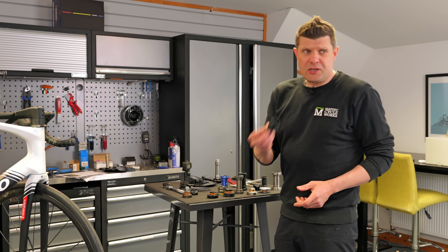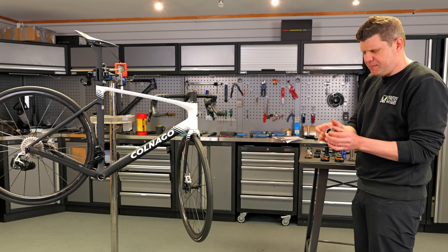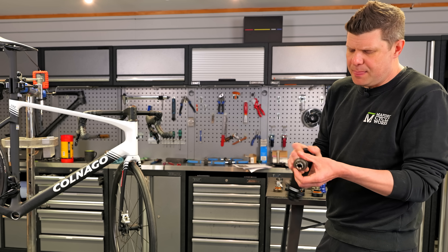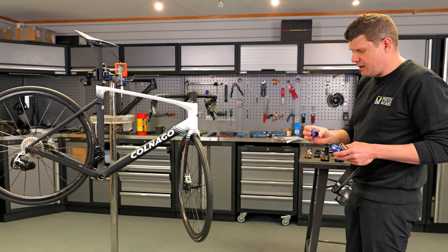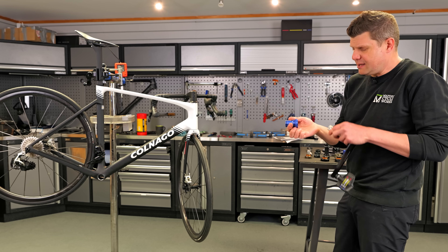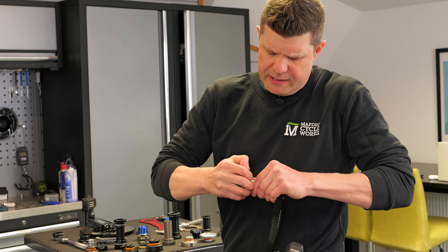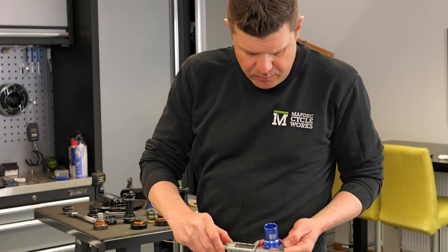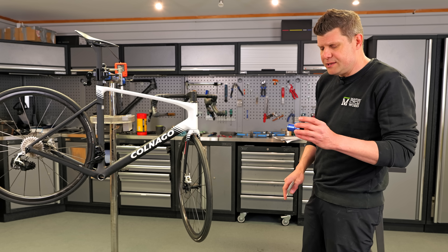What do we do about it? I'm not about to start machining the crank or the bottom bracket. However, there are other bottom brackets with different tolerance levels. The Hambini SRI has a Delrin top cap designed for compliance — that is a better fit and spin, but it has such a large edge. The Baconi, which also sponsors the UAE Emirates team, has a little rubber O-ring for compliance. That is actually quite a nice fit with probably the best spin. Its contact patch is only 40mm, so I think we'll get away with it — but I want another look at the facing.